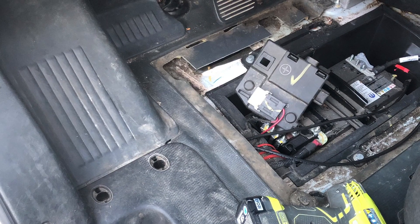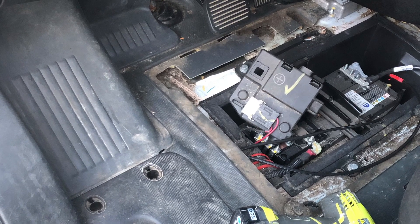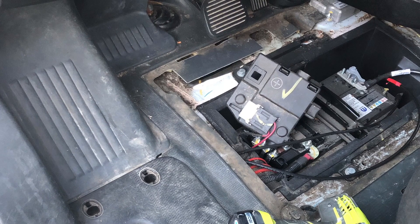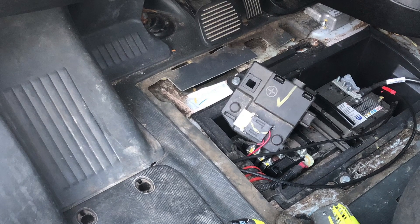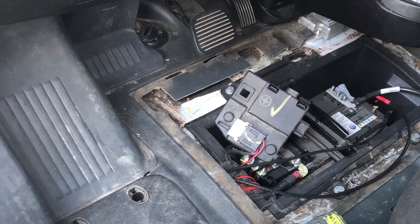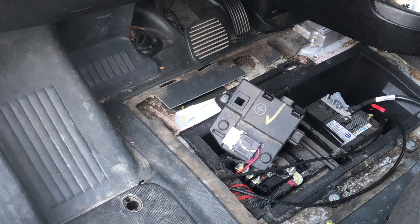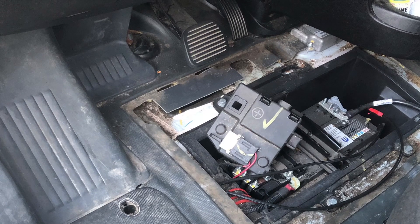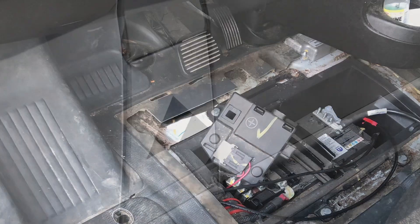What this thing does is push power through the alternator, through your car battery, and into your house battery — plus solar, which I'll get to. The last thing I wanted to show was the Pro Master battery location. These large sprinter-style vans don't have a battery in a normal place — the Transit might be under the passenger or driver's seat. Just look into where your battery is located. I ran six-gauge wire from the car battery, and four-gauge for everything else — if you're running longer than three feet, go with four-gauge. It's in the manual.